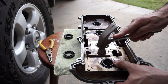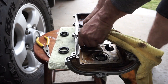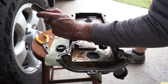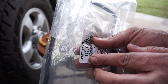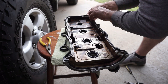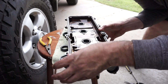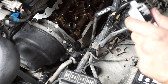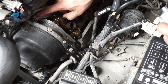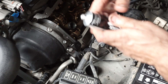The driver side gasket part number per research is 90080-10330 with the driver size. This is all done. We're going to go ahead and put some silicone on the head. One of the biggest things I was questioning when doing this is where to install it. As you can see, the gasket comes around this corner — I'm just going to put it right where the little hump goes into this corner, so that it seals in that corner. And I'm assuming the same position on the bottom.